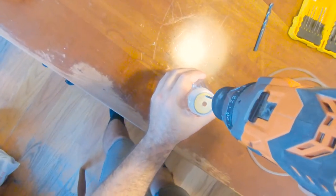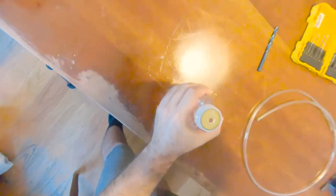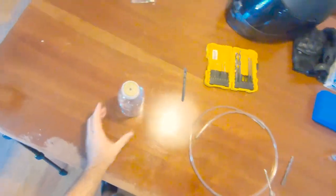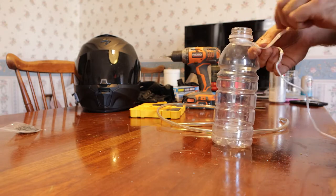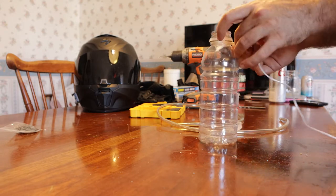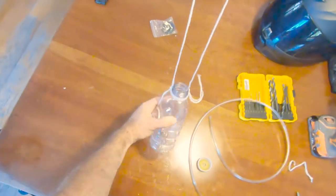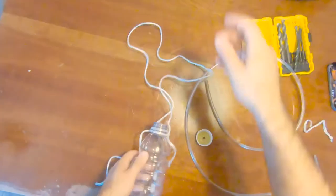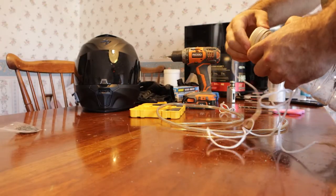It's large enough to allow air to escape from the bottle, but small enough not to cause a mess if you knock the bottle over. This part is optional, but as a final touch, you can tie a string around the top of the bottle. Using a string will allow you to suspend the bottle over the caliper without having to hold it. By keeping the bottle above the caliper, any air pockets in the tube will go toward the bottle instead of back to the caliper.